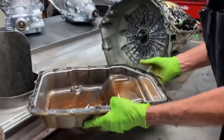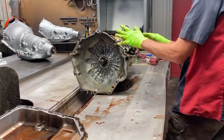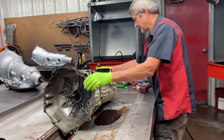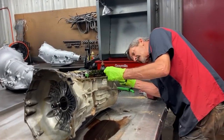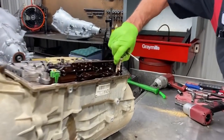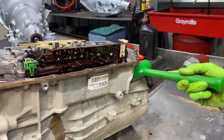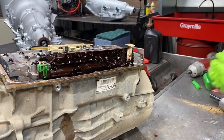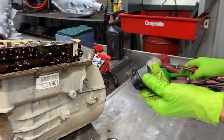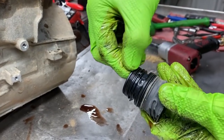I tell you, when we get into it, you take that chance of the pump bell housing being held. You get this — you push this little lever here, pull up on it, and it unlocks the harness connector right here. Give it a little tap, loosen it up, and then you can take some pliers and just wiggle it and pull it right out. Now there are three O-rings on here — two round ones and one square-looking one right here.